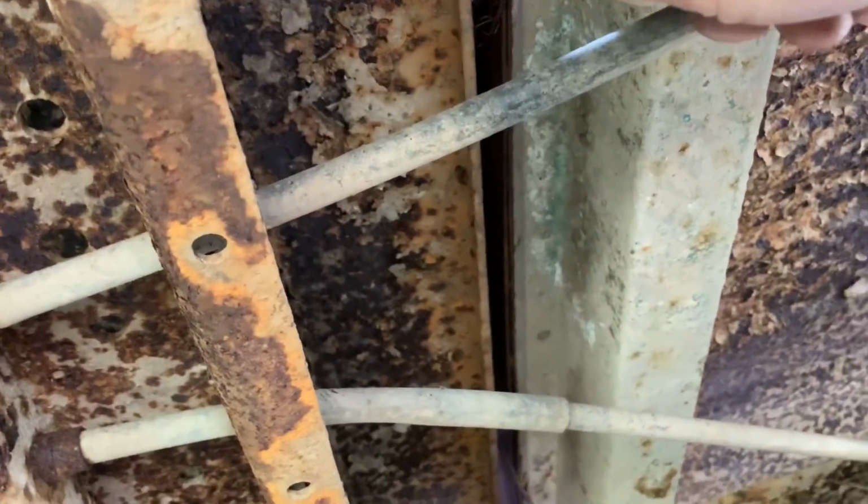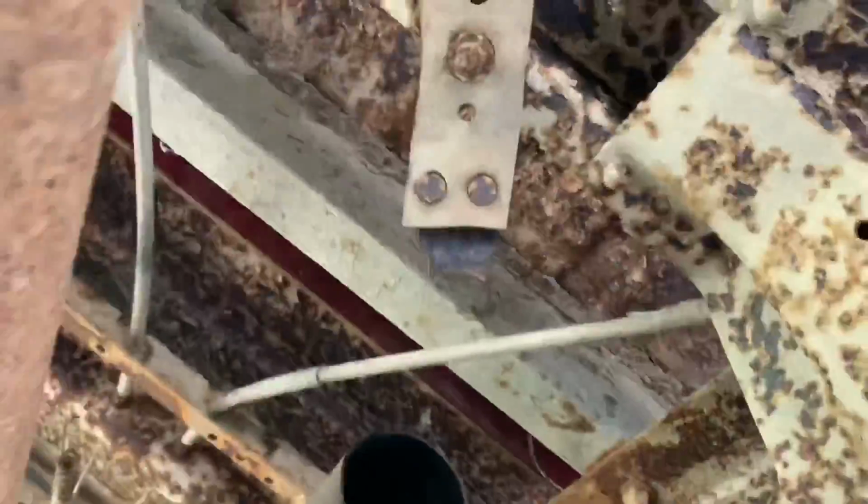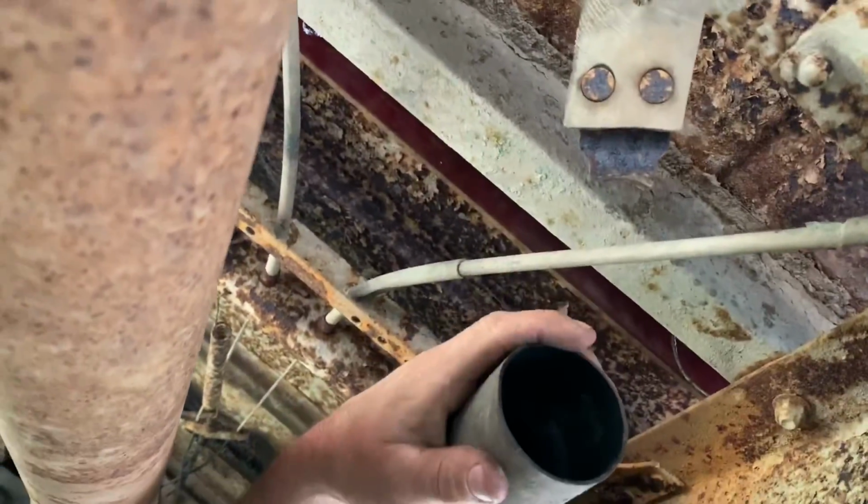So I'll put a clamp there too, and I'll leave this straight pipe, which will get me, see friends, it'll get me past the cab. The cab's here. So when you look down, you want the muffler past the box. You don't want it floating around underneath the cab. And as you can see, it's not. See? There's the muffler exit here, and the cab's there. So that's actually a bonus.